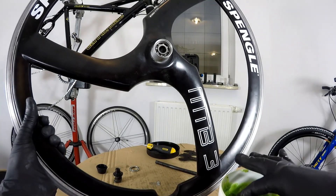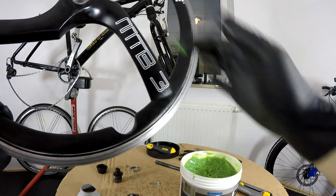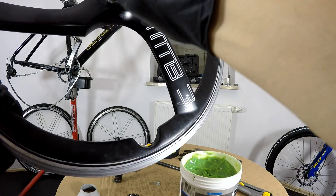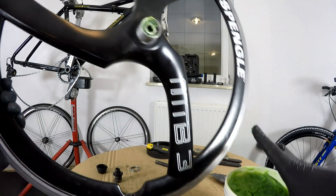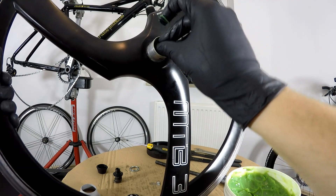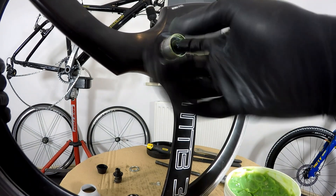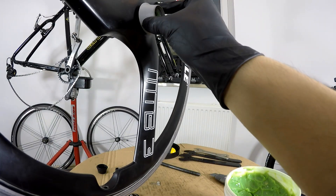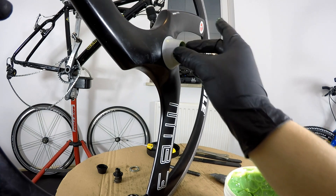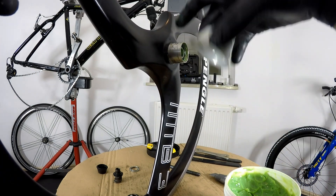On the non-drive side, super easy — we simply pack in my beloved Shimano grease, which is very good for hubs and also very good for all the bolts in the bike, the headset — I like this grease. Now we are closing the bearing and it is working in a very, very smooth way, I'm very happy with that. On the non-drive side there is this quite large — it's not rubber but kind of plastic — it's very well made, because when you lock it into place it looks like it's a part of the wheel. There is no space for water or dirt to come in, and this hub was really clean.